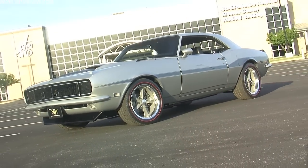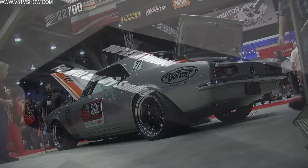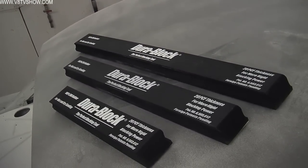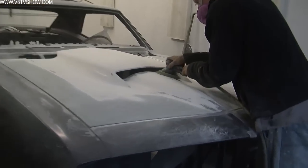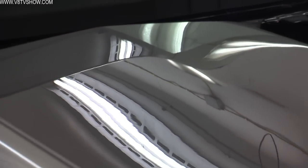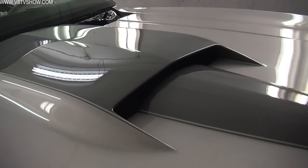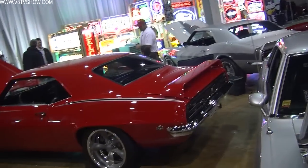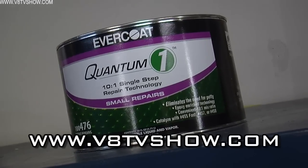So if you're going to do a show car, make sure you get the body panels lined up in steel as best you can. If you apply body filler from end to end, you're going to want to block sand the car from end to end. Make sure all the panels are installed so that your fender, door, quarter panel, trunk lid, even the roof skin can all be sanded down to the same level, giving you an arrow-straight mirror finish when the car is sealed, painted, buffed, and polished. This whole exercise was designed to point out some of the pitfalls of body filler, but also show that if it's done right and care is taken you can really rely on a good body filler to make your car stand out at the car show. You can learn more about the Evercoat line including Quantum One and other fillers reinforced with fiberglass or Kevlar or metal.